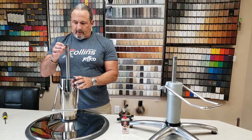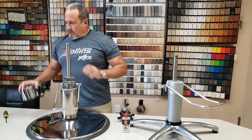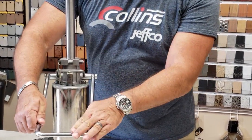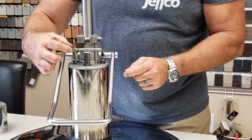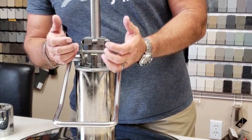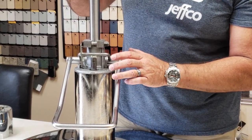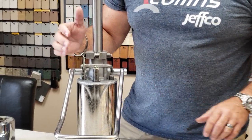We're taking the screw off this cap and the roll pin out so we can remove the cap and look inside the pump. There are only one or two lubrication points in here. The main one is what we call the yoke — it pushes down your plunger when you're pumping your chair up, so this is a wear point, as is where this cam or fork is. Occasionally if you start hearing a squeaking noise, you can slide the cap up and apply a little bit of grease at the yoke and the fork — that should make it go away.